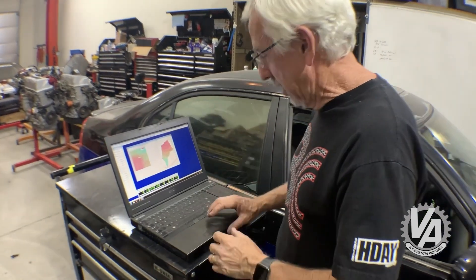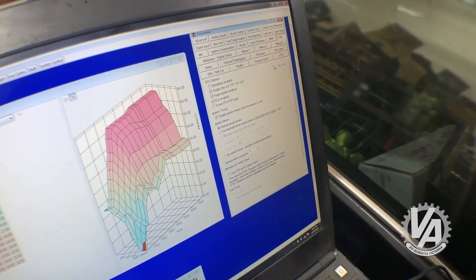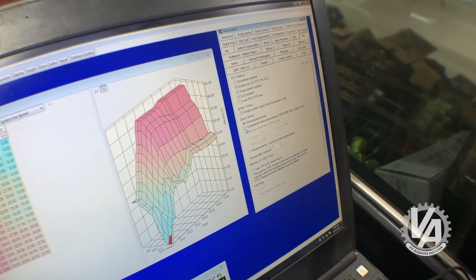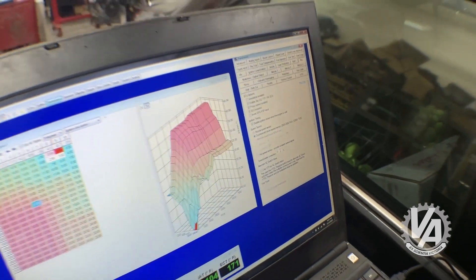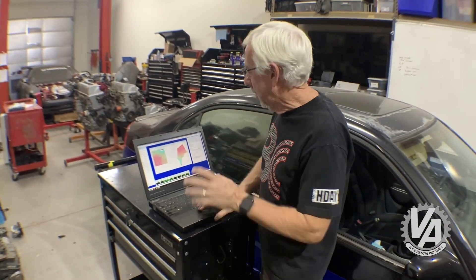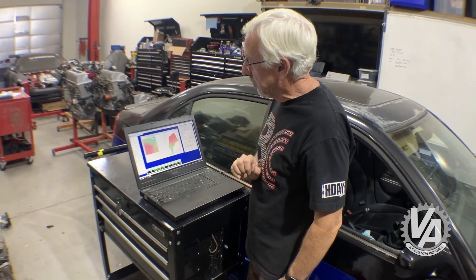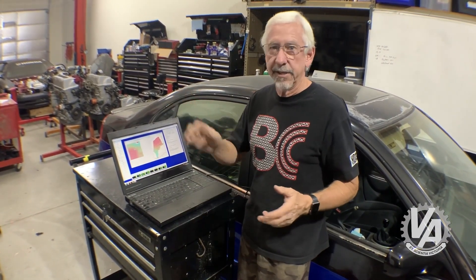Once everything's wired up and installed in the car, we need to upload the correct parameters to our computer. We're hooked up now with the ignition on. Come to Parameters, click on that to open the screen, then go to Miscellaneous. Come down to where it says Normal Speed Sensor or, right below that, Countershaft Driven Speed Sensor — select that. There's also a speedometer correction setting there; we have a video on the VTech Academy YouTube channel showing how to use that. Once done, upload the program by hitting the up arrow. Don't forget to save it. Now our program is uploaded and we're ready to go. As we drive around, we're going to notice the correct signal coming to our instrument cluster without pegging.